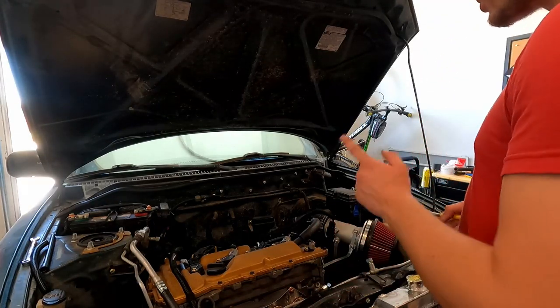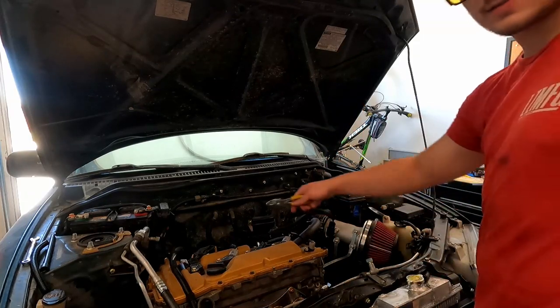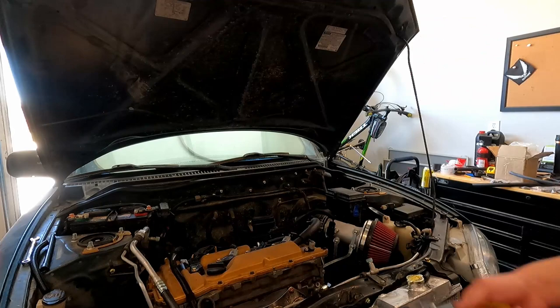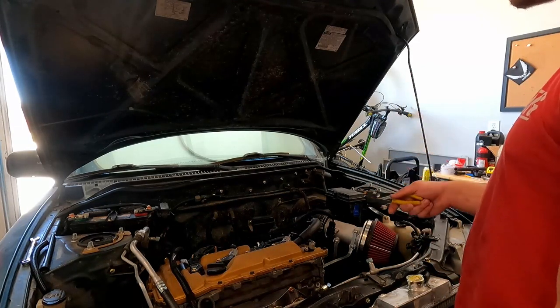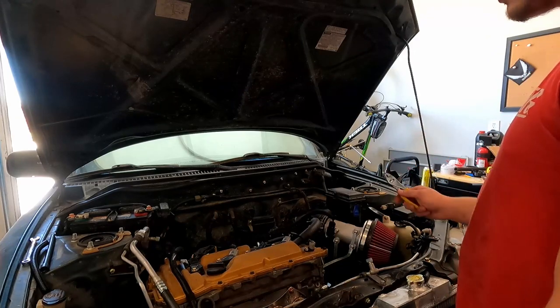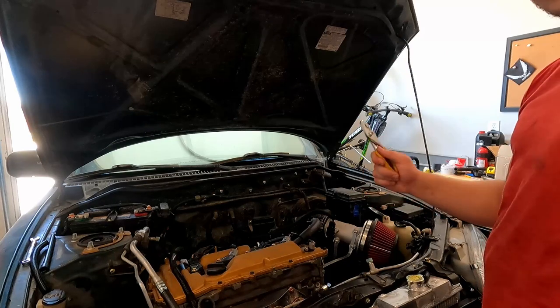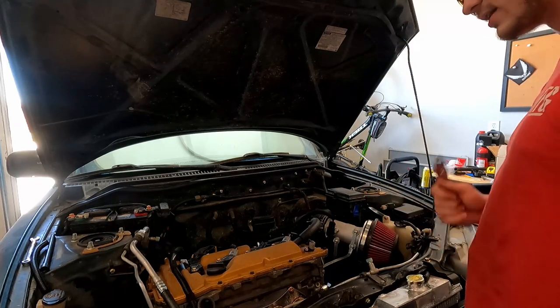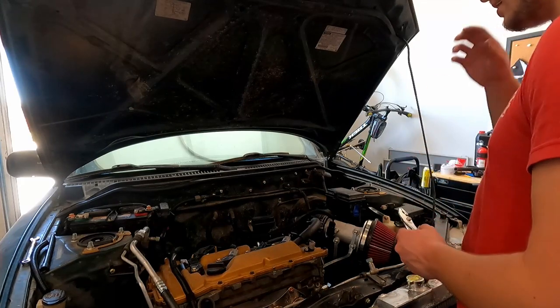With that, I actually have a tiny coolant leak on the heater hoses. I've got some constant tension spring clamp fittings, and they're ever so slightly the wrong size. I think I ordered one size too large, so I need to get the next size down because there's a tiny leak there. They did not leak when I had worm gear hose clamps on them, so I don't think that there's anything wrong with the heater.